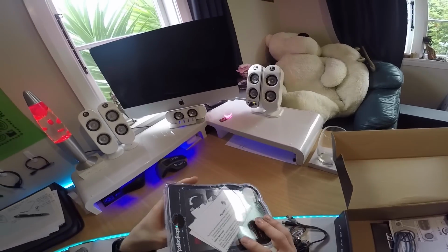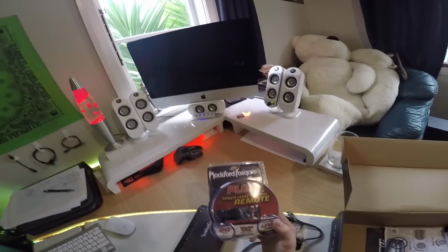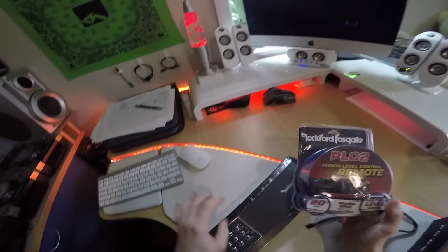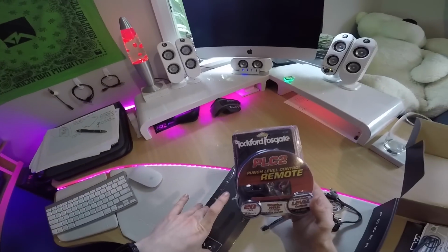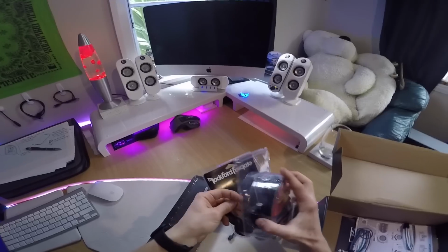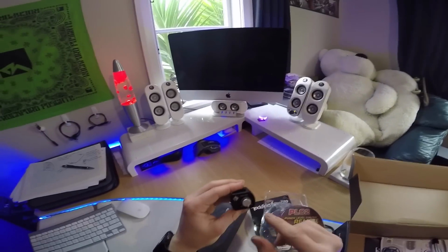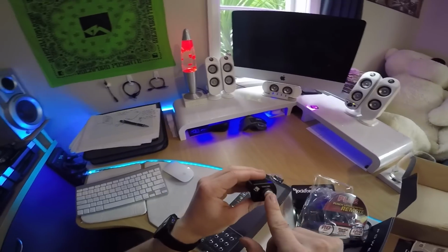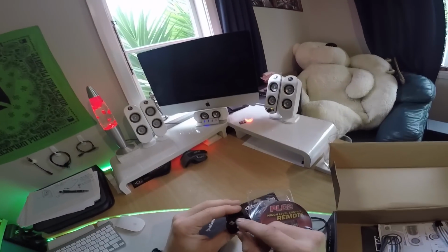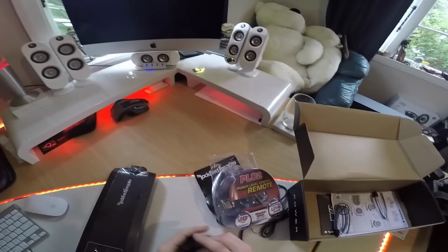What is also good about these is it doesn't actually boost up any bass or any frequencies or anything like that. This is purely an attenuation knob. So typically what you would do is have the gain turned up a wee bit extra, and then have your attenuation knob, which is the unit. See if I can get it out here for you. So that if you had it at maximum, it would be the same as just not having it plugged in at all. But then you can have the ability to turn it down if you want on certain songs. So I've gone for that. Hope to flush mount it somewhere nice in the car.